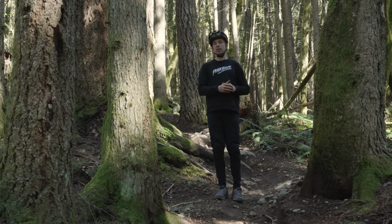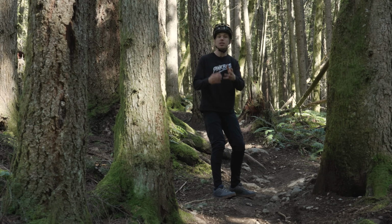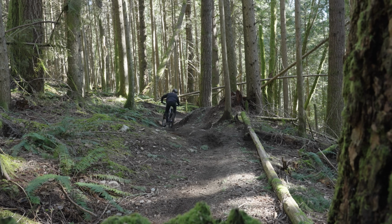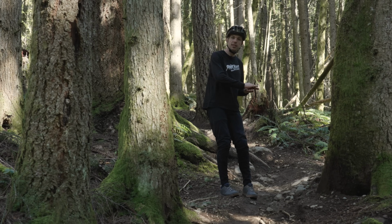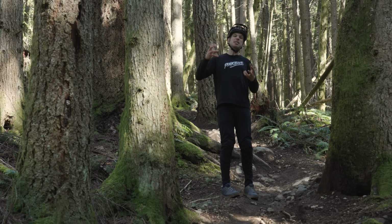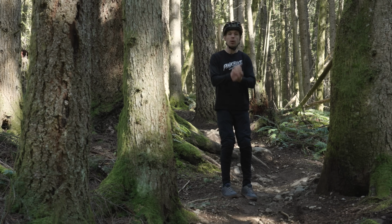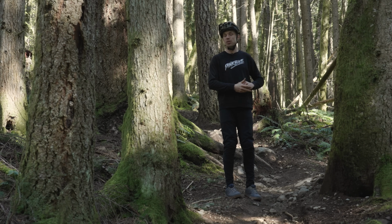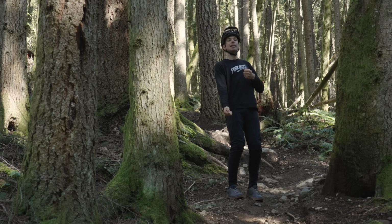and that ratcheting motion. Now, this isn't an issue when you're coming down a rough trail at high speed because the free hub is not only letting you free coast, but is doing a great job at separating those forces from your bike and body, and your suspension can work nice and freely. The issue is when you're going at quite a slow speed and undergoing some deep pronounced impacts. That high axle speed, using all that travel very quickly, means the free hub can't really keep up, and at the slow speed it's not already up to speed and spinning. That means that under those large impacts your feet get a big tug.